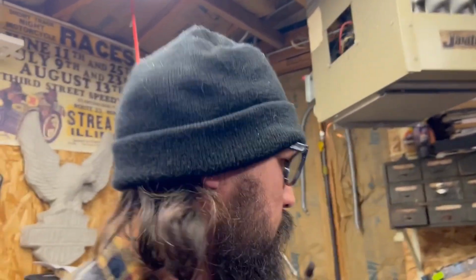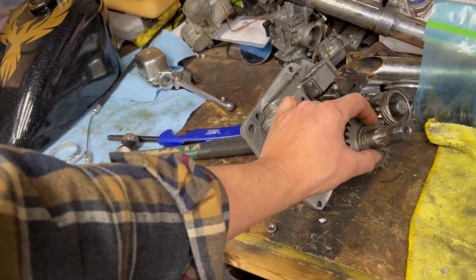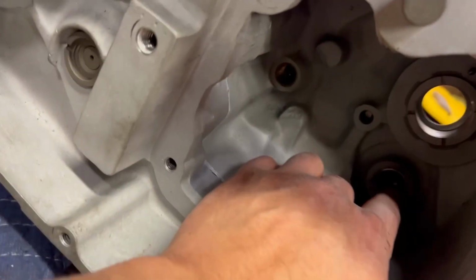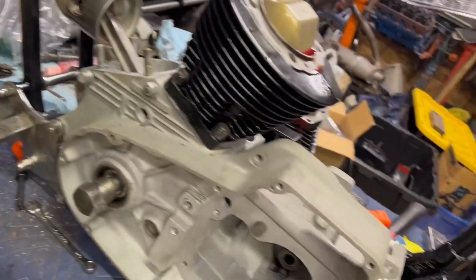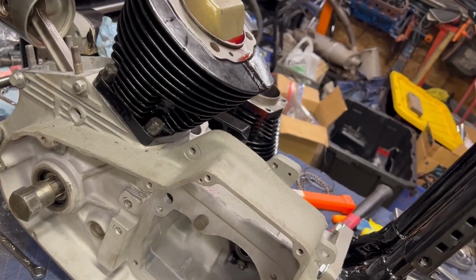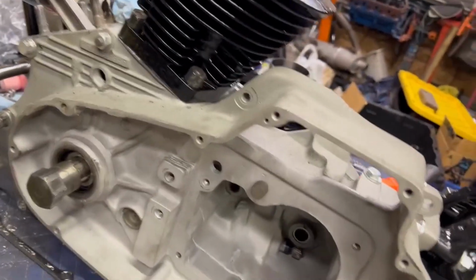Nothing in terms of the details or setting up a transmission, but needle bearings, main shaft will ride on the needle bearings here. That's what we got to load up into the case here. Countershaft is fixed into the fixed bearing cage. So let me grab a bunch of grease and lube these up. We'll load the bearings in, and then we'll come back to the transmission.